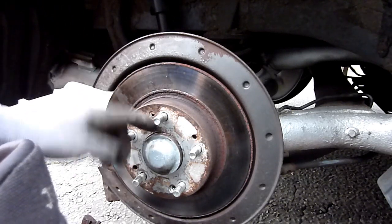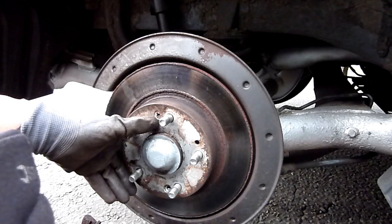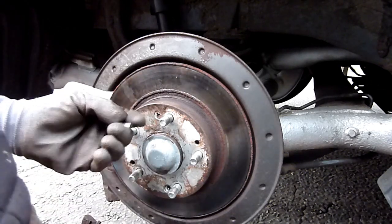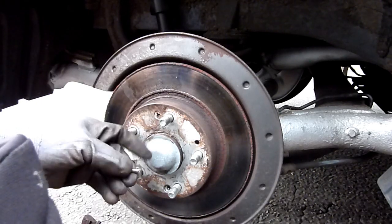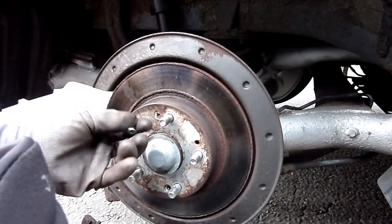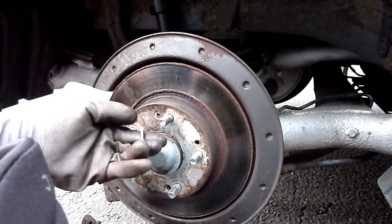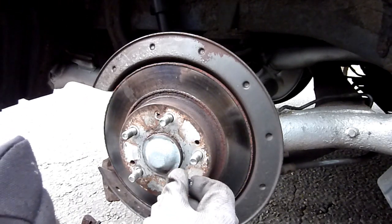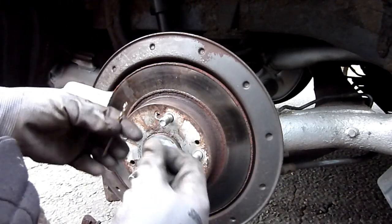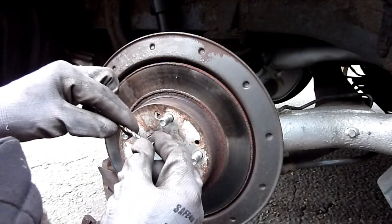What we're concerned with is these little screws need to come off first. Always handy to have a spare because looking at that, the diameter of the thread is really deep, but these ones here are not very deep at all. The ultimate drill I needed was the 4mm, and 4mm fits nicely in there.